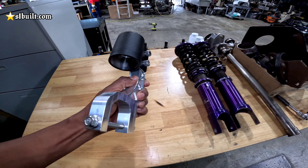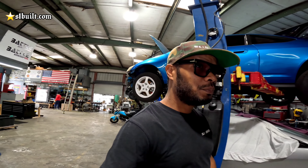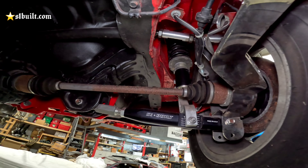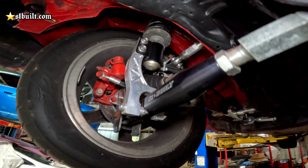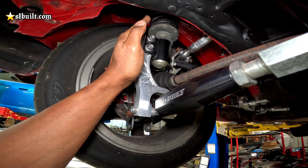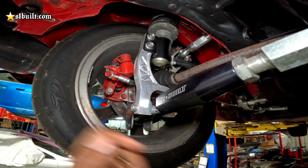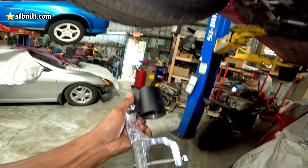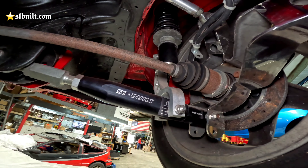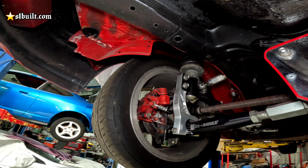These are our billet forks. If you go all-wheel drive, I'm going to show you really quick over here on one of our cars. When we build our kits, we purposely put our diff mounts just a little bit more back that way we can have as straight a CV joint as possible. For example, if you use lower control arms that are offset, it tends to push the shock strut a little bit back and that puts a bind on it. You can get away with it with an offset lower control arm, but what we recommend is our billet forks. As you can tell, they're curved right here so you can have more clearance to have a straighter axle.